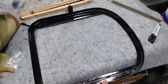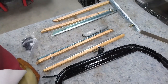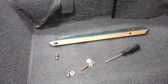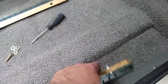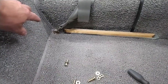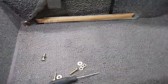In order to install this seat frame in the car, I need to install the tracks and that means putting more holes in the carpet. I'm going to use a similar method to what I used when I put the holes in for the seat belts. Three of the bolts go into a captive nut on the underside of the floor, and then there's a stud on the rail that goes through the hole and gets bolted in from underneath. To locate the holes I'll use an awl and poke up from underneath as close to the center of the hole as possible.